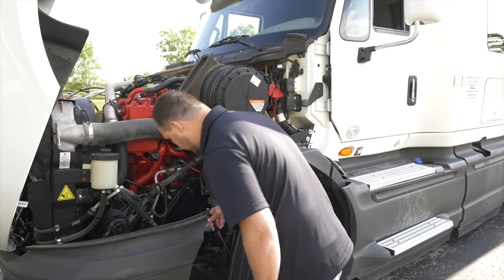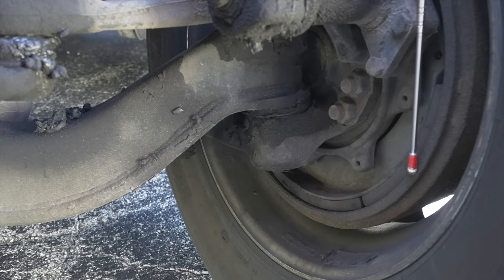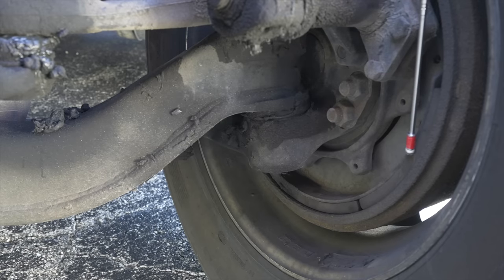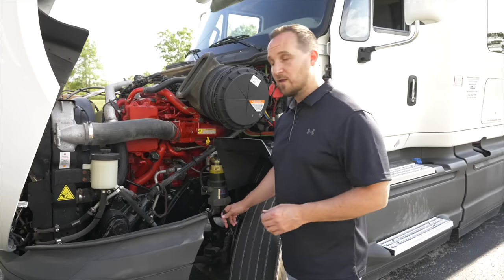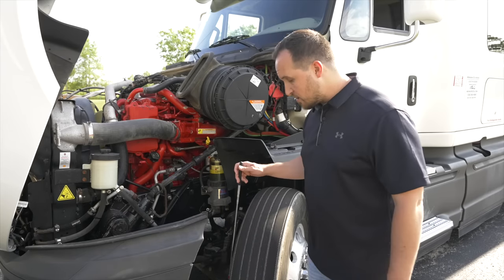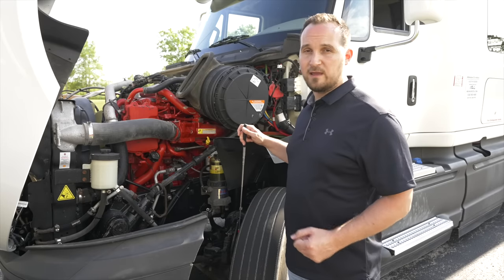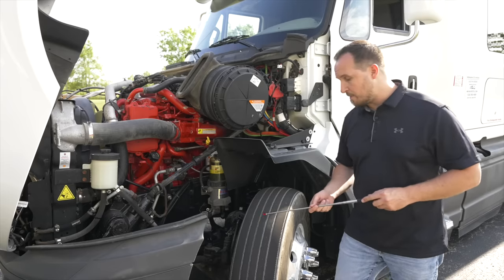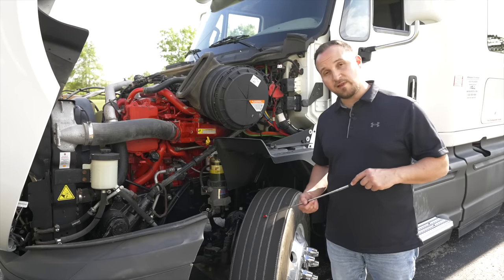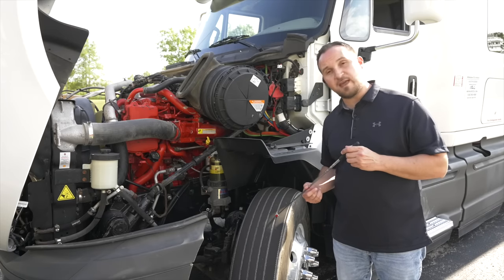Inside the wheel, we're going to check for our brake drum. The brake drum is not broken, not cracked, on secure. My brake pad lining is not broken, not cracked, on secure. There is at least a quarter inch of padding to be safe. My inner tire wall is not broken, not cracked, on secure, no cuts, no leaks. The top of my tire is not broken, not cracked, on secure, no cuts or leaks. My tread depth is a minimum of 4/32nds of an inch.